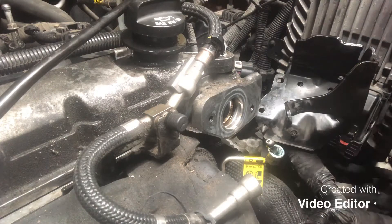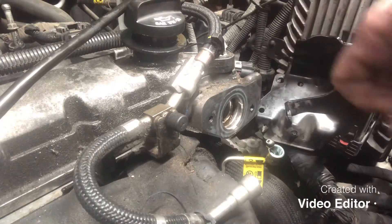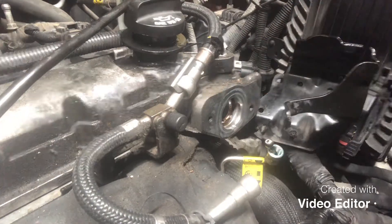I'm going to spray it down again, let it sit here for a few minutes, turn the motor over, and while it's out here try to grab a hold of it and pull it out. In my mind, that little piece — they call it a cam follower or something like that — that thing should just, you should be able to pull it right out of there, or at least move it back and forth with those needle-nose pliers.